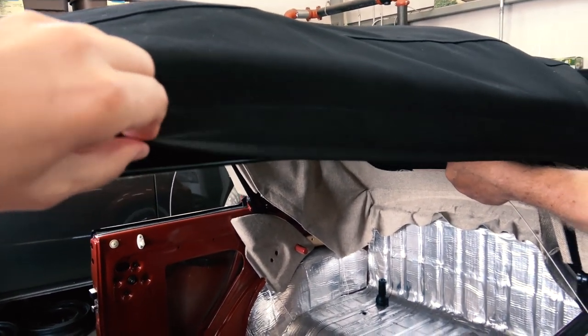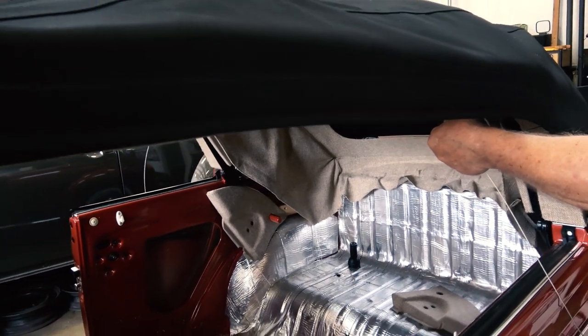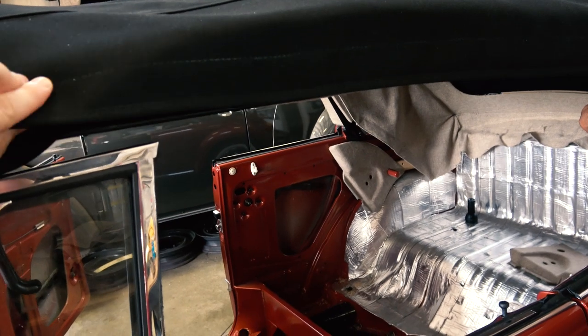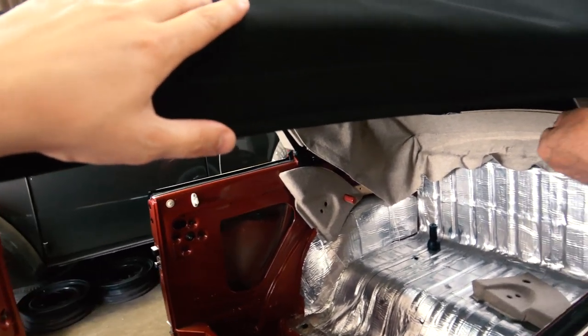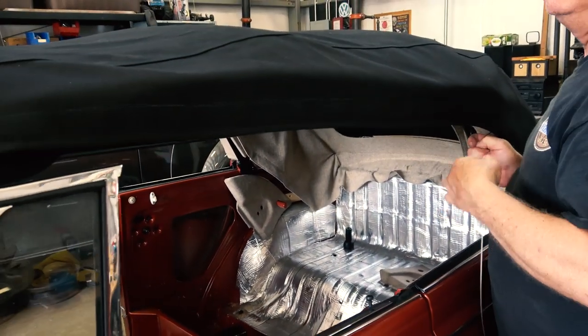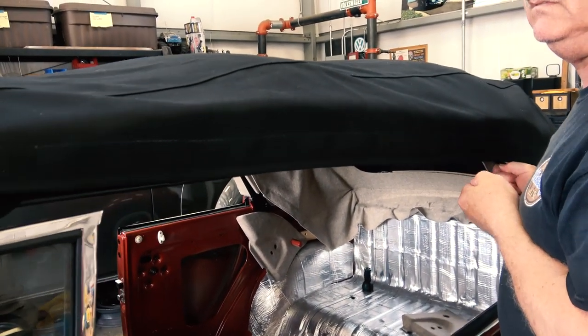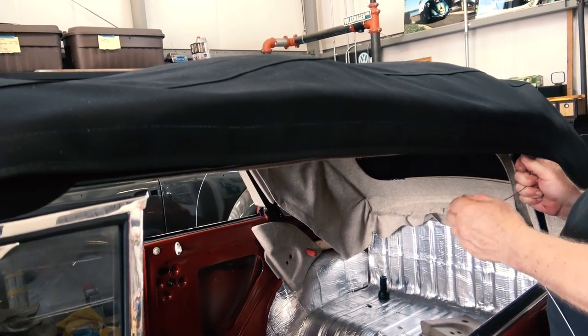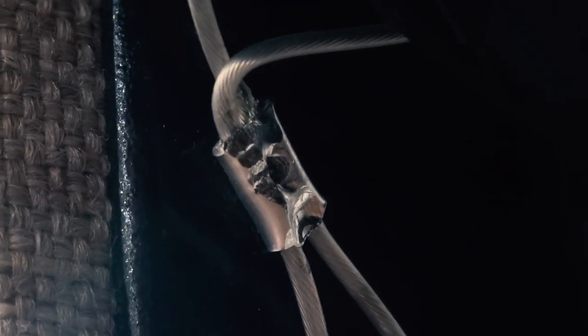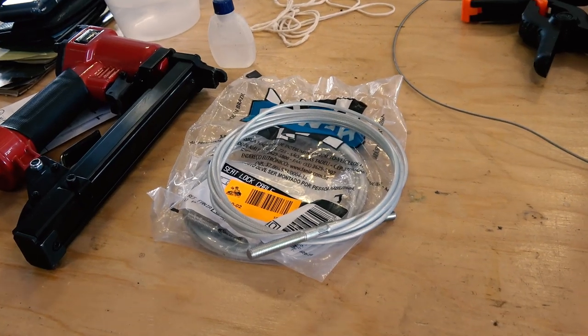What this outside cable does is keep the top tight up against the frame when the top is closed, and even when you go to open it, it doesn't go wandering. It keeps nice tension and gives it a nice line. Pull it tight enough so you have enough tension and some spring to it. The cable runs on the outside of the facing and goes up into the top. We also crimp that piece so the wire doesn't back out. Just use a typical wire crimper.